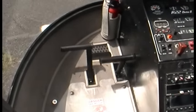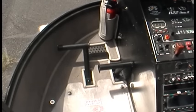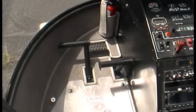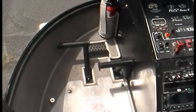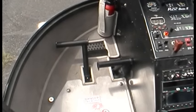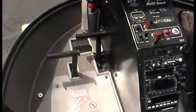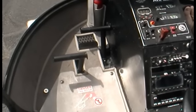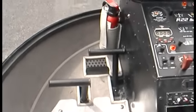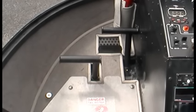If I push left, it's pushing the push rods and connections all the way back to the tail rotor, increasing the pitch, and by increasing the pitch on the tail rotor it increases the amount of thrust. This is what we use to push the nose left — it does that by increasing the thrust on the tail, which pushes the tail to the right and the nose to the left. And the opposite: by pushing the right pedal in, we're reducing the pitch, reducing the thrust, letting the torque take over — which swings the tail of the helicopter to the left and the nose to the right.